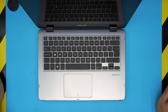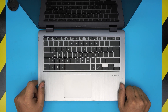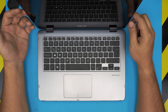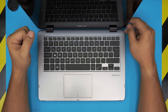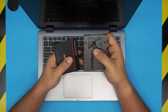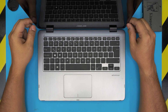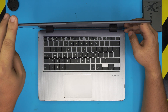In today's video we have an Asus VivoBook Flip 14, exact model TP410U. I'm going to show you how to speed up the laptop dramatically by upgrading the hard drive to an SSD, because the mechanical drive is the bottleneck for the CPU. Once you upgrade to an SSD, it'll improve performance hugely. I recommend the Samsung or Crucial brand - do not go with cheap Kingston or Adata. This applies for any VivoBook Flip 14, not just the TP410 model.